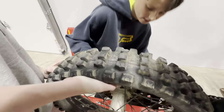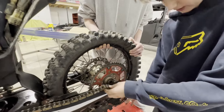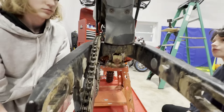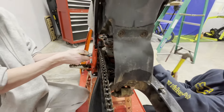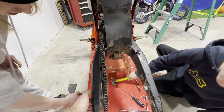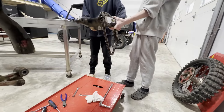All the way out. You got to push the wheel forward so you get the chain loose, then roll the chain off of it. Come off — pull it back and roll it off the side. Now your swing arm is free from there. Go ahead and keep hitting over there, Braxton — punch that through. See that there? You're going to just pull out on that. Come back here and grab the swing arm and just set it on the ground for a second. Let's get the chain off of here and set it over there.